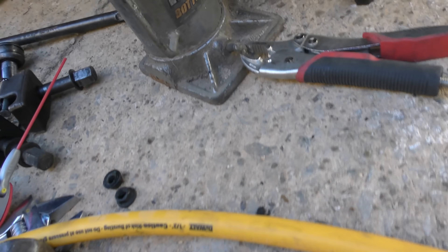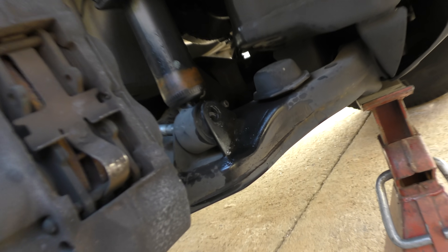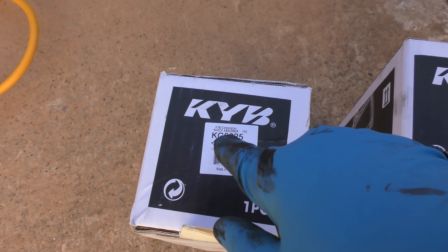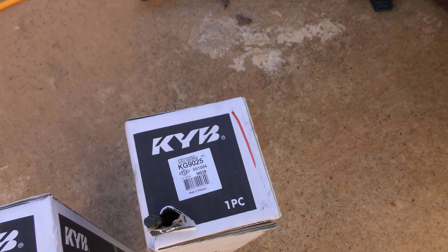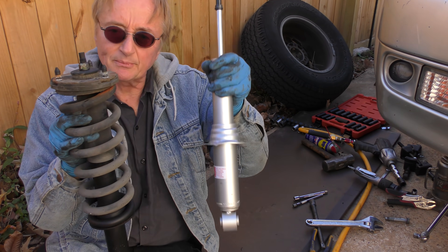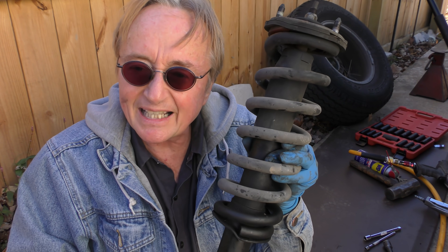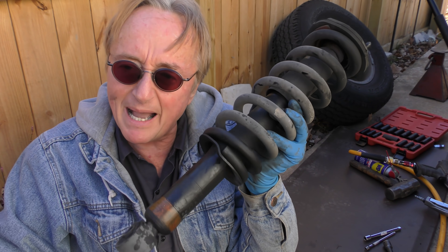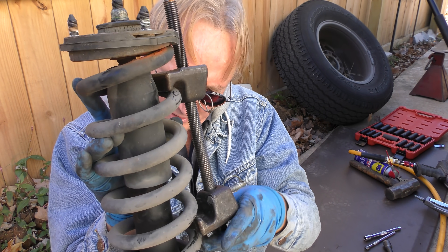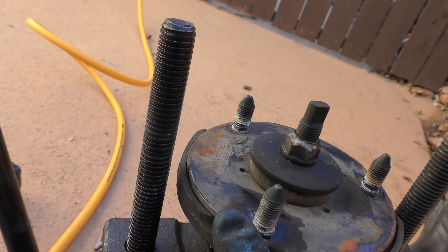Since it's a big truck, to make the job easier you can use a bottle jack on the bottom — when you jack it up, the holes will line up better, which makes the job a lot easier. Then remove the whole assembly. Since the shock is inside, both sides use the same part number: KG9025. The only problem with this design is the spring is under pressure and you've got to compress it to change it. So out come the spring compressor tools. These are the original Toyota parts — they lasted 386,000 miles, so pretty well made. Screw the spring compressors on, one on each side, and get them snug. Then tighten them so you can loosen the top nut without it flying off.